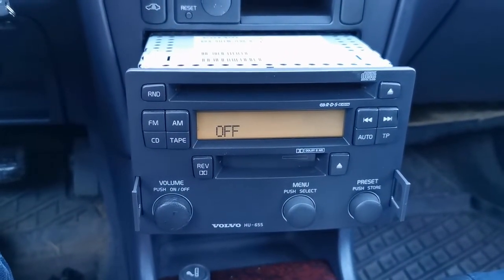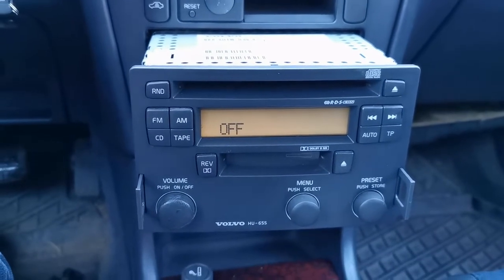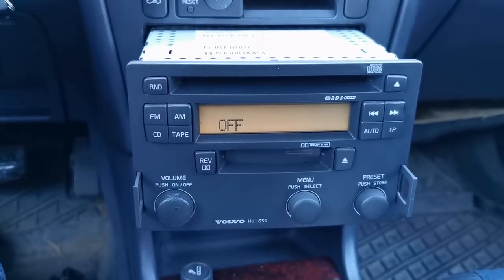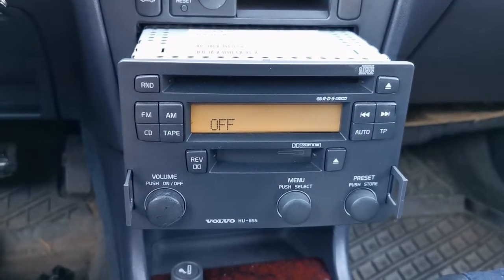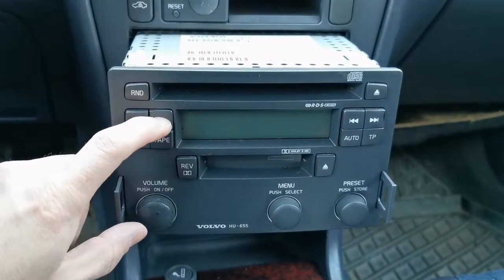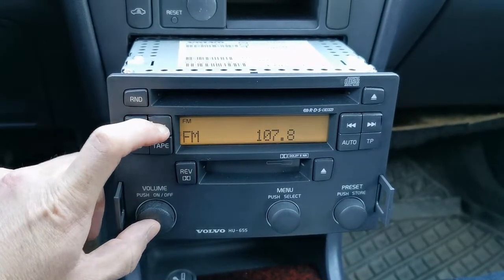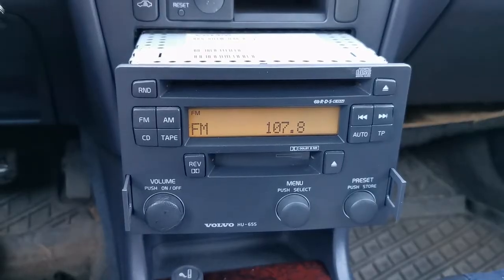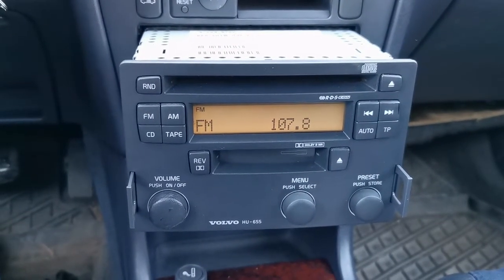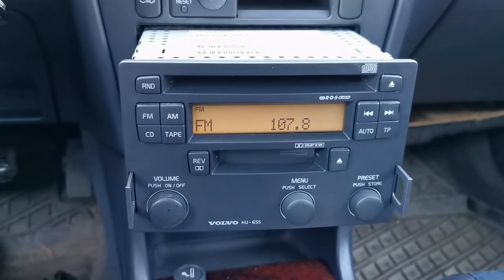Now we need to get around that. To unblock the radio, switch the radio off, then press and hold AM while switching the radio on. You can see it shades — the radio switched off but it's in test mode, and gives you around five minutes only to perform some actions on the radio.